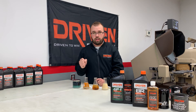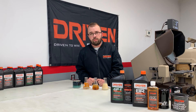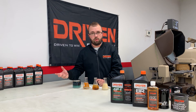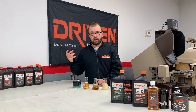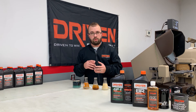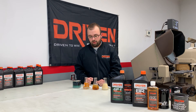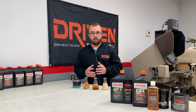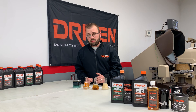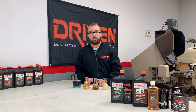I don't recommend zinc additives. Zinc additives are kind of a crutch. For one, it's not already mixed in with the oil, and it takes temperature and load to mix in with the oil. Until that run-in time happens and you get up to temperature, it's not mixed in yet. It's also like playing chemistry Russian roulette — you don't really know how it's going to mix together. In the next part of this video series, we're going to talk about the actual break-in process you should follow without a dyno. Thanks for watching — see you in a minute.